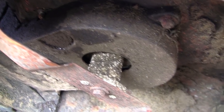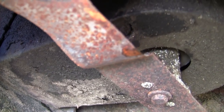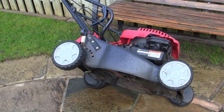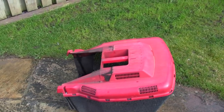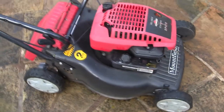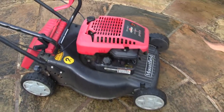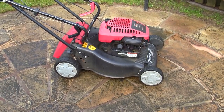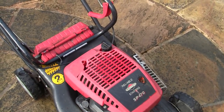I'm going to clean off the bottom of this - usually with a pressure washer or a wire brush - and take off this actual drive belt guard here, clean all this out, and make sure there's a belt on there so the self-drive works. If you don't have a self-drive on the one you've picked up, it's one less problem, but these resell for a lot more money with self-drives. Make sure you buy one with a grass box. I have an oil extractor so I'm going to pump the oil and fuel out, but if you don't have one you can just tip it out into a tub. One tip: if you can get the lawnmower running first to warm the oil up, it will come out a lot easier.